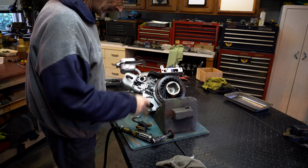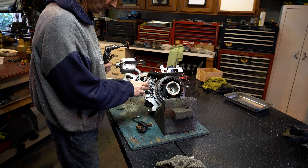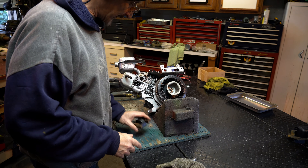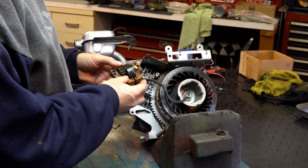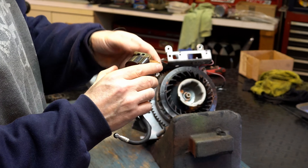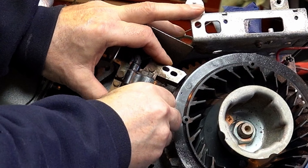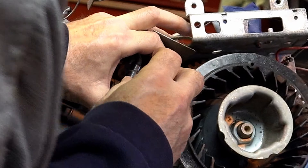Since I put some paint on this thing, we've got to clean off the standoff so that we have a good ground or connection point between the body of the engine and the body of the coil - and that's something I do anyway. I already did the coil itself and cleaned it off good so we have no issues there. This says 'cylinder side' and this says 'this side out' - you probably can't see it but on this coil it has that. I always put oil on the screws.